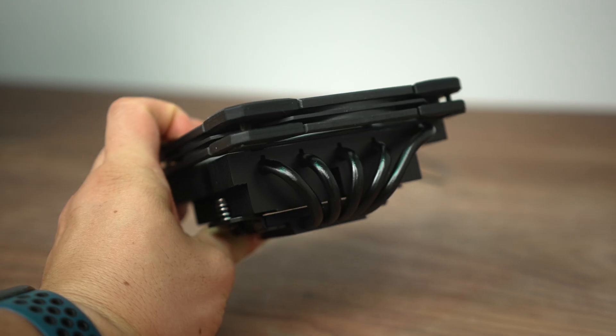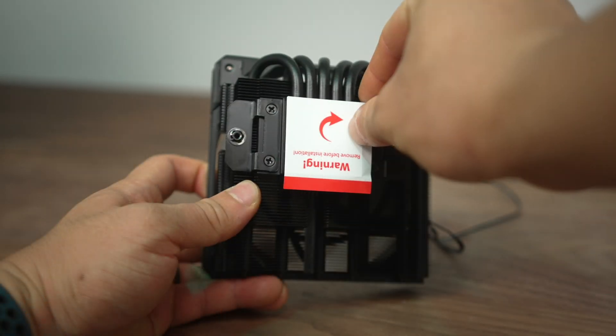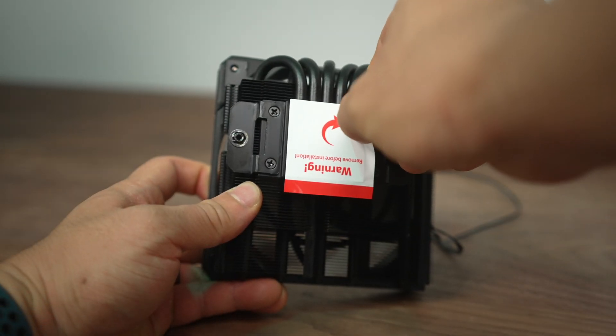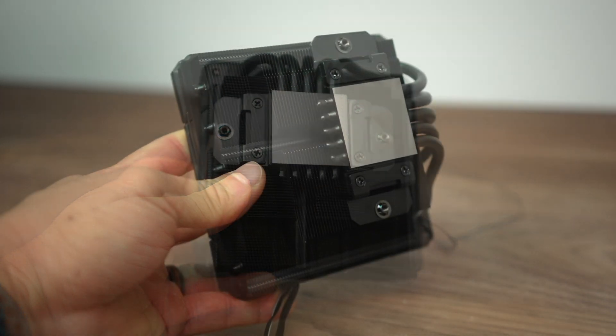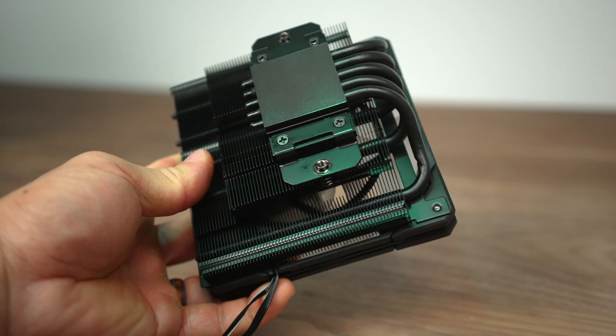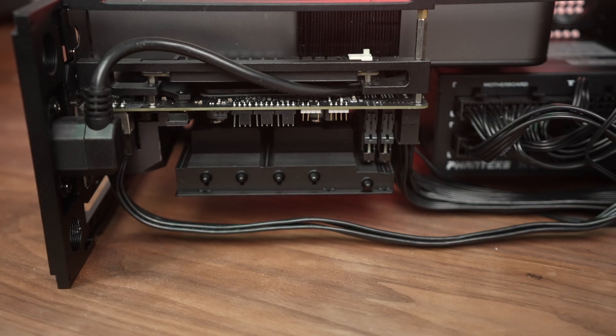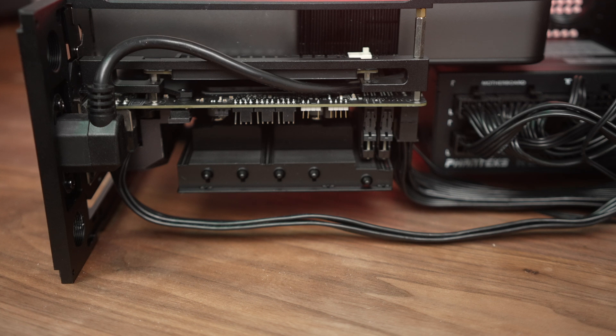It's so thin — the bottom, everything is only as thick as it needs to be while putting as much heat fin space as possible. The cutouts are also quite generous, and I measured the heat sink at exactly 40 millimeters. I did have to run a Corsair LPX RAM kit to clear it, but for this size class and type of case, it's a pretty normal concession.